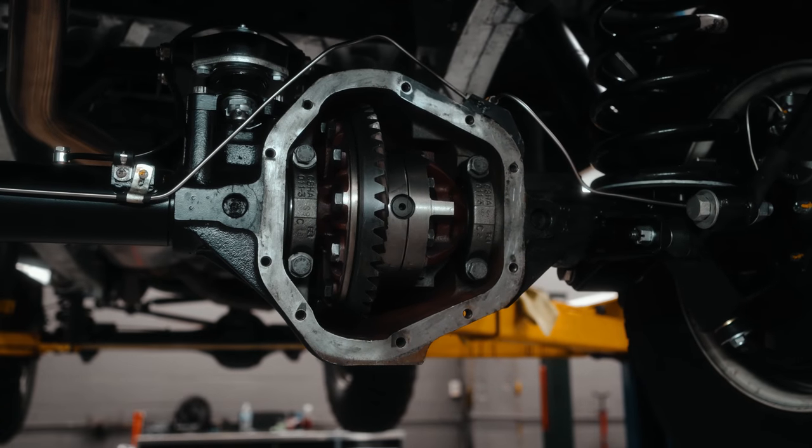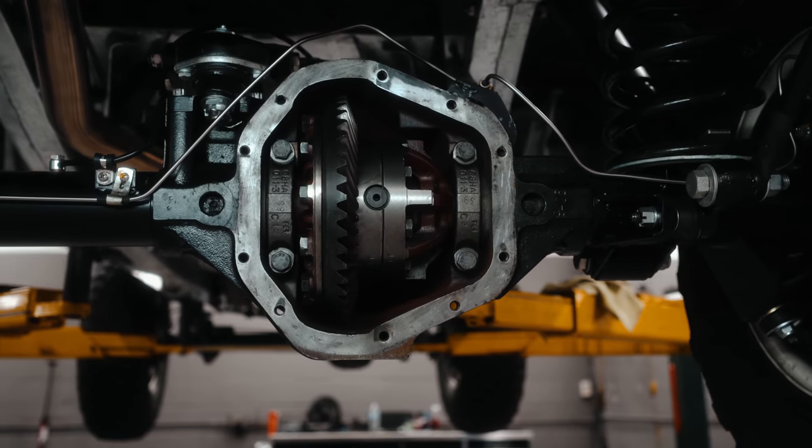These are the heavy duty differentials as seen in most of the older 109s and 110s, early 110s. They're different from the regular Land Rover differential, which is a removable pumpkin that has the differential inside of it. Fantastic differential, heavy duty. It's very rare that they give any issues, but occasionally bearings wear out.